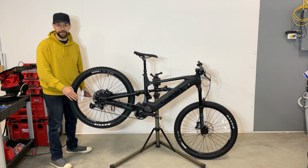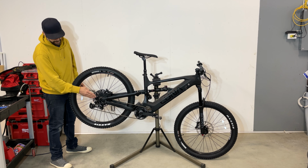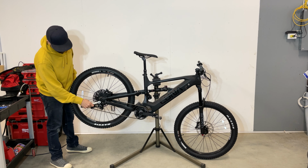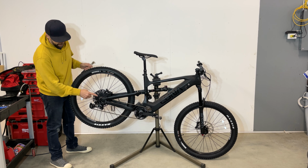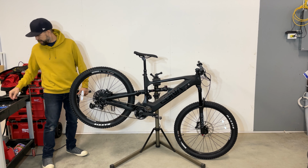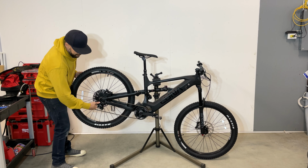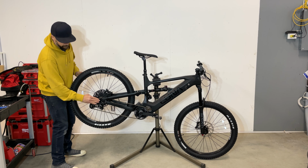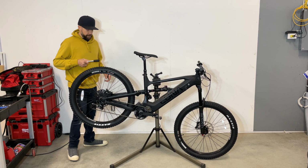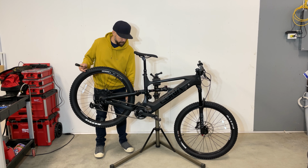It's possible during shipping it got banged up and it's not super straight and you do need some adjustment. If for any reason the hanger is not super straight, I don't have the right Allen here, but you can take an Allen wrench in it and pry the derailleur so the hanger will be straight. Then once the gears are okay, you can move to the pedals.